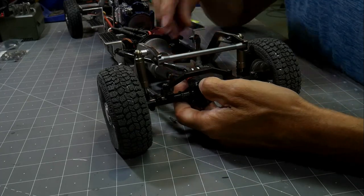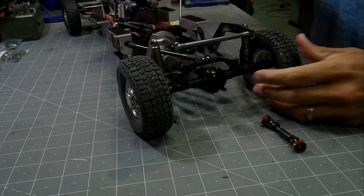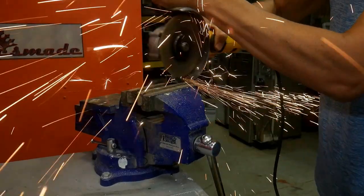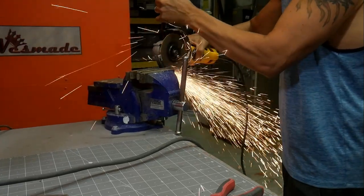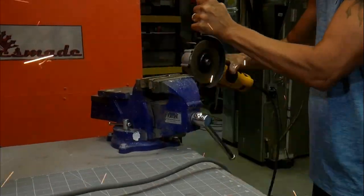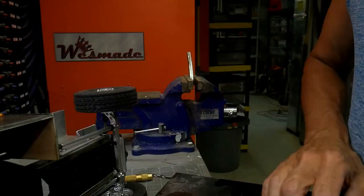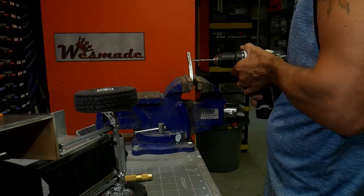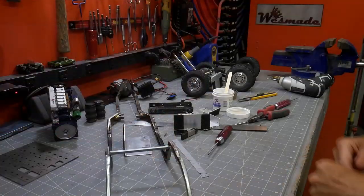I finally got my really short drive shafts in, so now I can test out the chassis and make sure everything's functioning properly. In the back, the fenders went way past the end of the chassis and were a little floppy, so I wanted to give a little extra support. I found a piece of half-inch box steel that already had the perfect bend in it, cut it down the middle while it was together so both sides are matched, and attached that right to the end of the chassis. It really did work out to be about the right size.